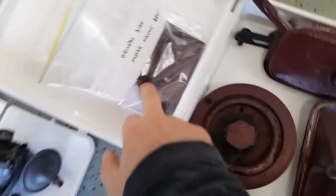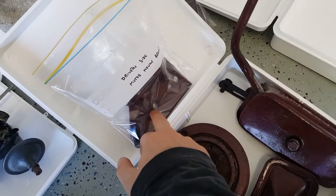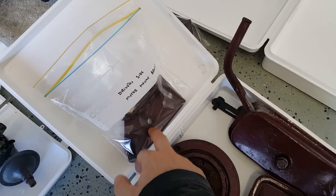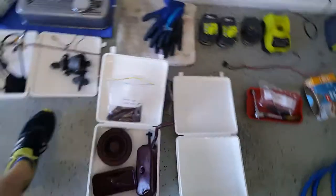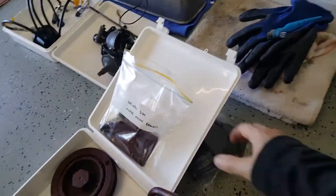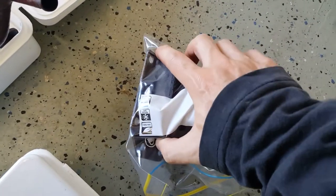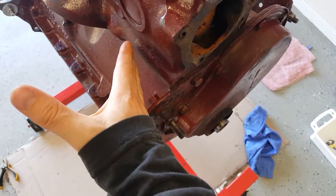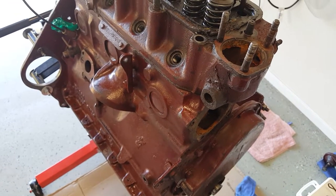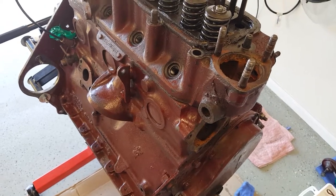The pulley itself is off. One thing I did note, and I've had a bit of an expert come to have a look at the internals of the engine, is that the actual motor mount on the driver's side was a little bit bent, and the rubber on that side had actually started to lift off. The rubber's actually started to come away from the metal, so it was canted in at a bit of an angle rather than being flat with the engine block. So I'll get a new one - they're not too expensive, I'll possibly even get a second-hand one.